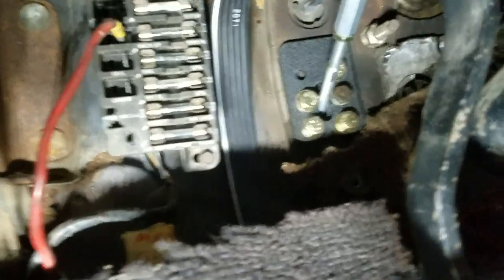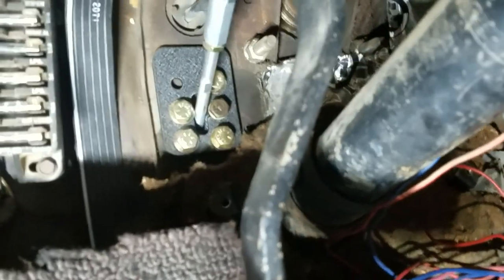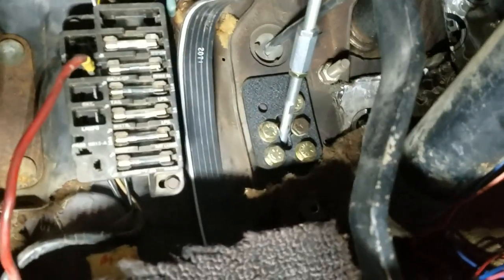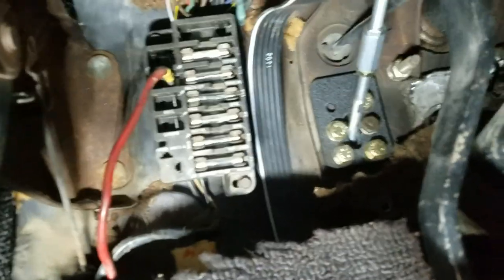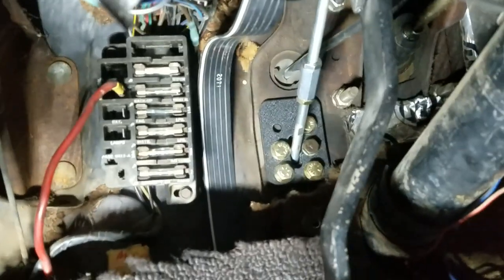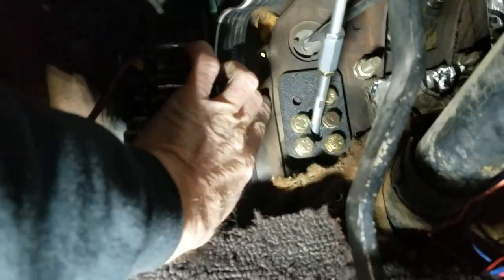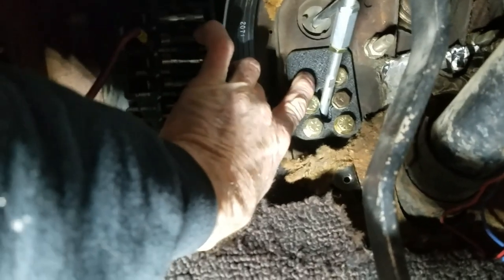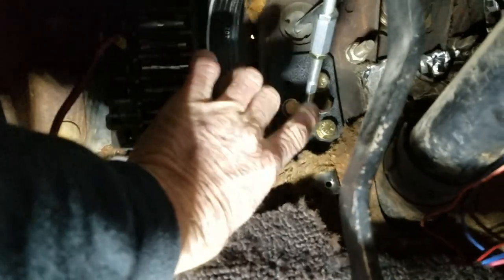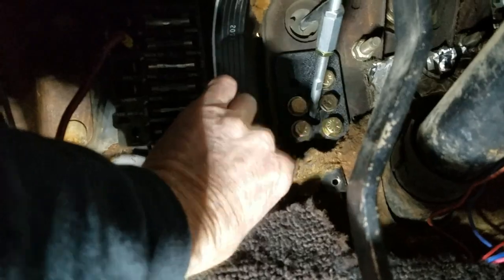Now your brake pedal area, the rod going through the brake pedal up there, your master cylinder and booster are attached to the firewall. There is 3 layers of steel, you can see the 1 layer right here where this lip is. And so I'd be drilling through 3 layers of steel just to get 1 more bolt in. So I think 5 will be enough to give us some strength and keep it from moving around.